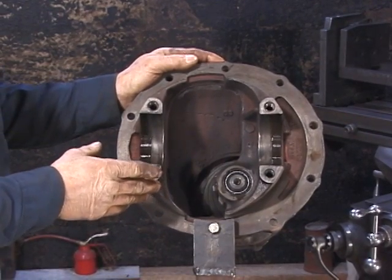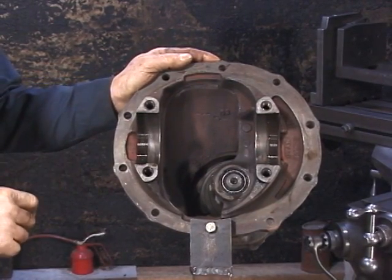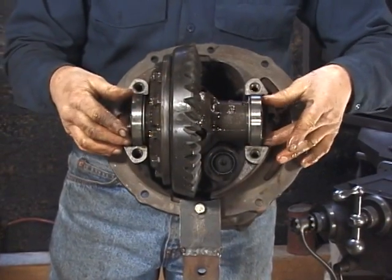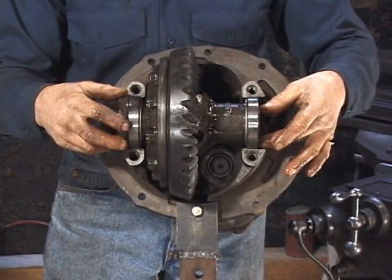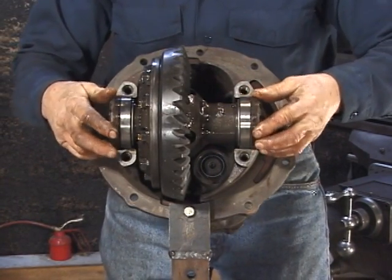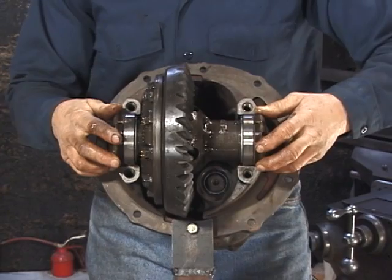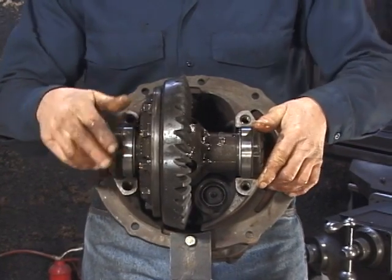With our correct pinion depth established, we can install the ring gear assembly. We want to first lubricate the adjuster threads in both the housing and the bearing caps, and lubricate our carrier bearings with some light oil. Then we're going to install the carrier with the outer races into the main housing. With the carrier laid in place and the bearings square in the bore, lay the adjusters in along the side of the bearing and down into the thread. Make sure they're not binding or cross-threading. Tighten up on the bearings until you have no play and check where your backlash is. The backlash is a little loose, so we're going to slide the carrier over using our bearing adjusters. Snug the bearings up again—now we have nominal backlash.